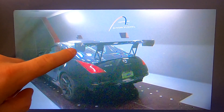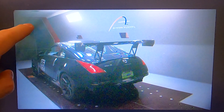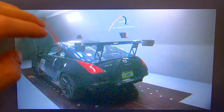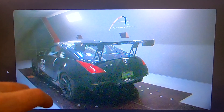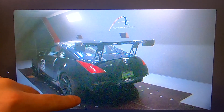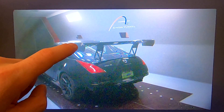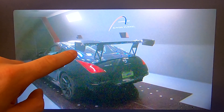This brought us to the rear of the car. This has another company's wing on the car, so we will not be sharing that data. As you will see, like any car we ever test, we always make note of wing angle, whether it has a gurney or not, and height. We even take a setback measurement from the axle centerline to the wing to get our leverage effect. To get this car balanced, we had a little bit too much in the rear still, so you can see we took a little bit of wing angle out of it.